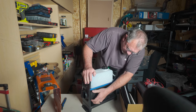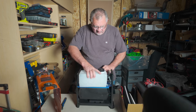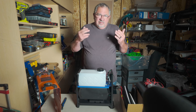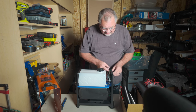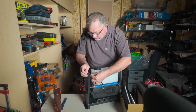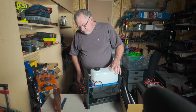What we have here is the heater unit, a fuel tank, and a fuel pump — pretty much it. There are some electronic controls in this piece and there really isn't much to it. The fuel pump right here is one of the bigger complaints about noise. It's a piston pump, so you have a metal piston going into a metal casing and every time it moves it goes slam slam slam — you're gonna hear that tick tick tick sound. I'm also going to replace the fuel line with a more solid one so it doesn't get pinched or compressed over time.